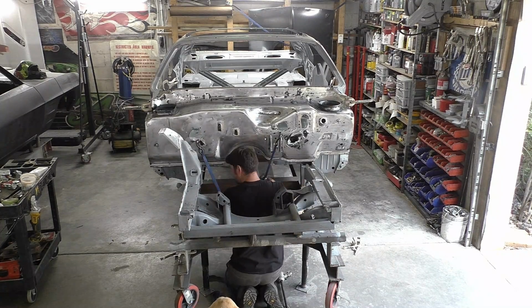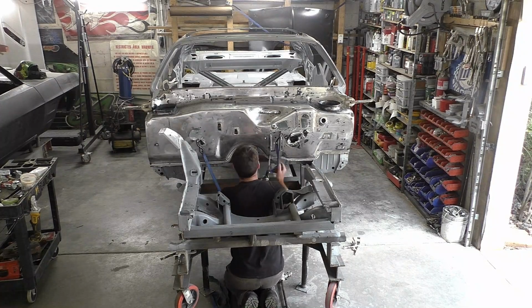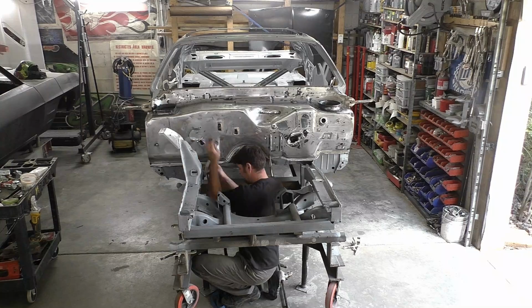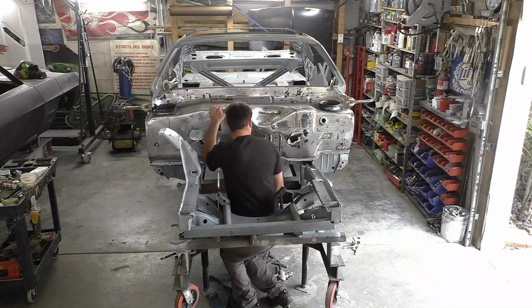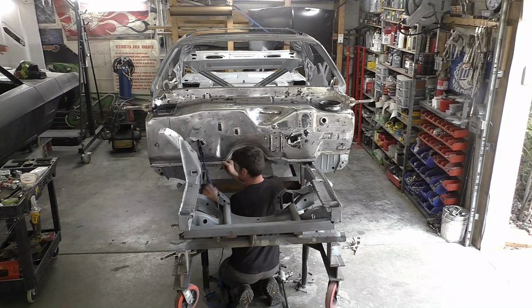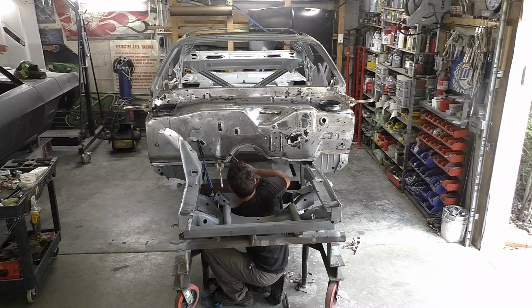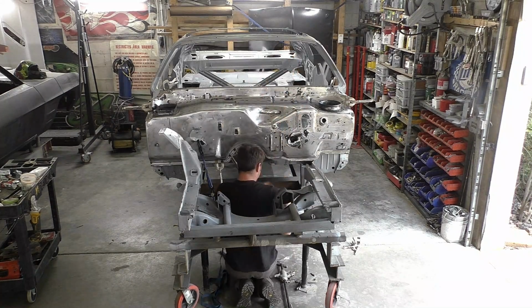So what I'm going to do right here, I did screw in down right under the windshield to make sure we're clamped up really good and our windshield channel is on track. I'm taking a ratchet strap and I'm basically hooking it up to where the heater motor goes, and wrapping around, just pulling that side down. I also did sometimes hook up where the electrical bulkhead connector goes and pull both sides down.